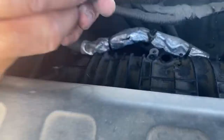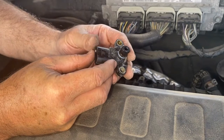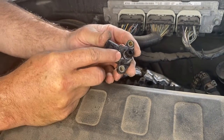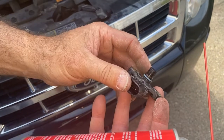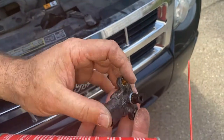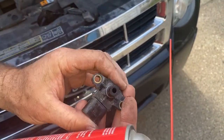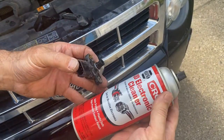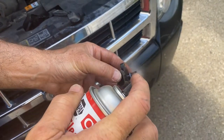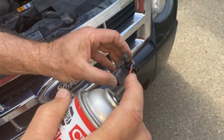You can see it's got a little dowel there it sits on, which is a nice design. On this thing right here, you got to make sure when you put the new one in or clean this one, put it back in so that the O-ring is in place. Even though this engine's got a code on it for a MAP sensor, I'm going to actually clean this and see if it does go off. I usually don't clean them like that, but I got some electrical cleaner and I'm just going to spray it and see if it actually shuts off that code.